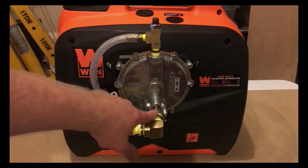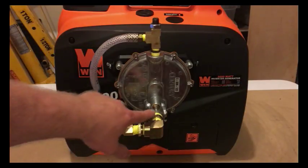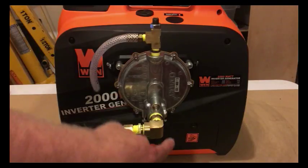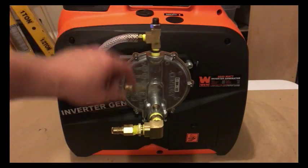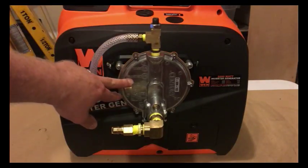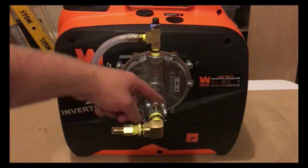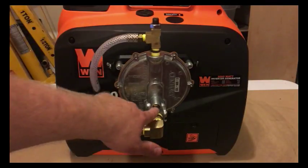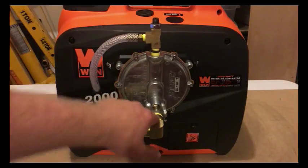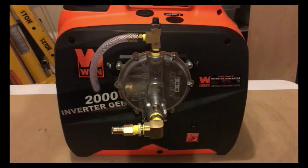On the regulator, this lower screw you shouldn't have to adjust, but when you unscrew the first one and take it out — that's just a cover screw — you can adjust the screw inside. That adjusts how much vacuum the engine draws; how much vacuum it takes to kick the valve open and let the gas through. Basically, this is a really sensitive low-pressure regulator: when the engine's running, it's pulling a negative pressure, and that negative pressure opens the valve and lets the gas through. If you've got a really small motor where the vacuum isn't pulling the valve open, you could adjust this, but generally you just keep cranking the motor over and adjusting the screw until you get it to run, then fine-tune it until the motor's running really well, and lock it down.